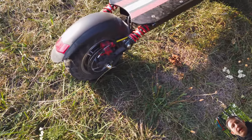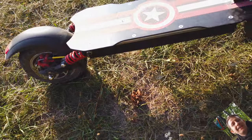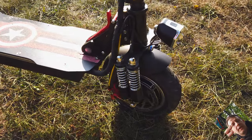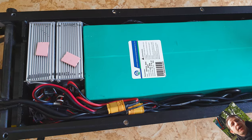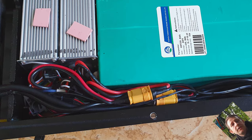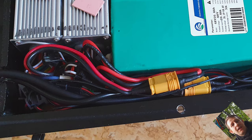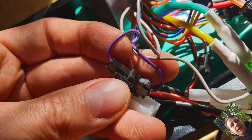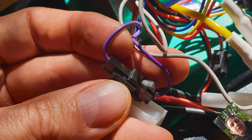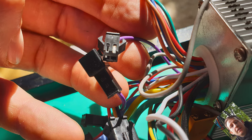Next tip is also about the brakes. If you've got the L8 fixed with dual levers, or the L8S, then you can disable the support for the brake system. I'm sure you've noticed that when you hit the brakes even a little bit, the rear wheel starts to brake quite badly. That's because in the ESC you've got built-in support for the brakes. It's super easy to disable this feature — just open the deck and find the violet connectors, like you can see in the picture. Just disconnect them — two violet connectors disconnected and it's done.